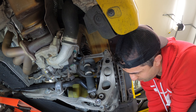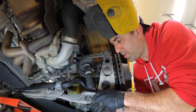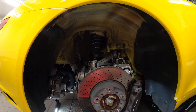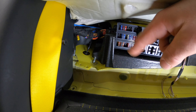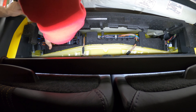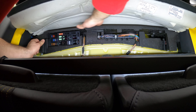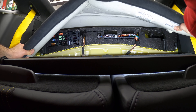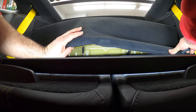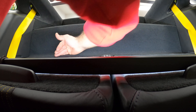Then tighten the shock, then do the inner arm first since you have to move this to get this bolt in, and last this control arm right over here. Finally, we're going to reconnect the leveling sensor, and we are done on this side. On the inside, let's reattach the nuts and reconnect the shocks. Let's put this styrofoam piece in — first you slide it on the passenger side; don't worry, you can push the fuse box in place. Then it slides in on this side as well. You bend it back in the middle, sort of make it into a little sandwich.